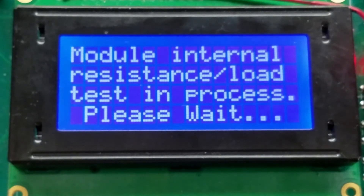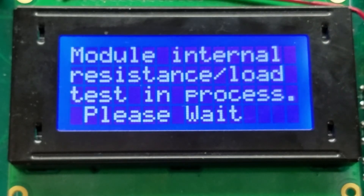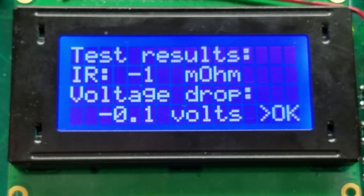You will apply a short 5-amp load to take off the top charge and record the voltage and current, then apply a 60-amp load for 15 seconds and again record the voltage and current. The system does the mathematical calculations and displays them to the user, and there are the test results.